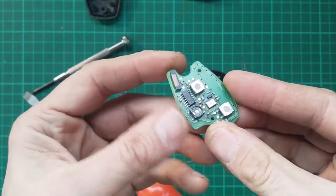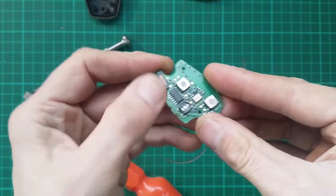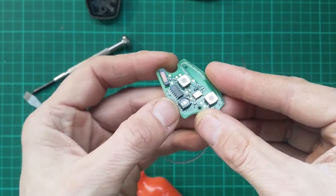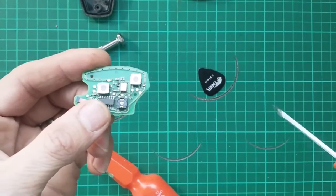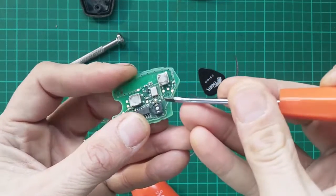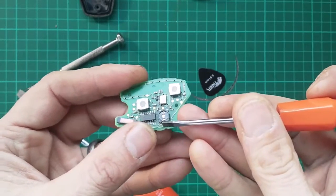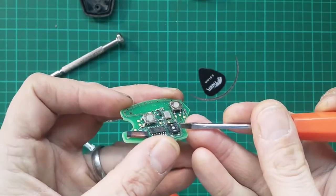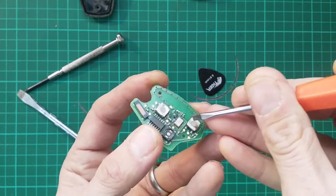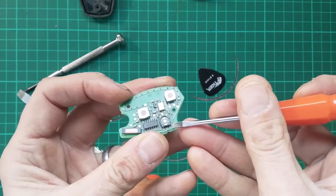This type of Renault switch often has 2 or 3 buttons depending on which functions the key opens. So in this case you've got an open, a lock and a boot open, and it's this lock one that's broken. So there's 2 ways to go at this. Firstly, I can either unsolder these 4 little joints here and swap a new switch straight in. Secondly, the alternative would be to see if I can replace just the silver and button piece that's on top of the existing switch, which is obviously easier and it avoids me potentially screwing things up by getting solder everywhere.